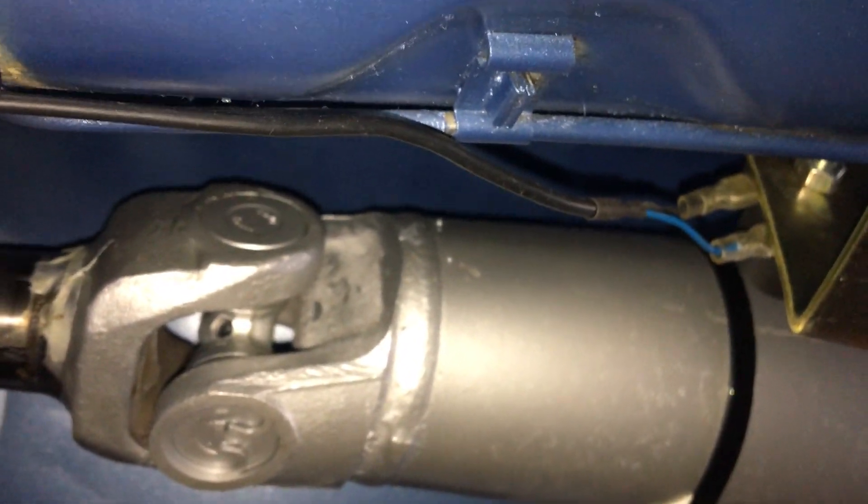There she is — there's your little magnet. You get the magnet on there and then you've got your pickup signal device, which needs to be three to five millimetres apart from the magnet. They say to put it as close to the transmission as you can — the transmission mount is there and that's where it's mounted. It sits in there nicely, it's easy to drill a couple of holes. The bracket mounts right underneath the seat so you don't see it. Do a bit of galvanised anti-rust paint on there first. This is a cable shifter setup on an FMX, so the cable just goes back — and that's the setup down underneath the car, very simple and pretty quick to do.